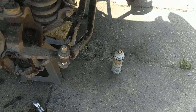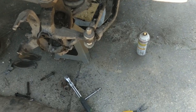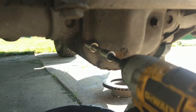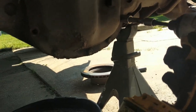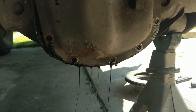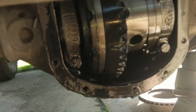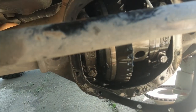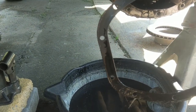Hub and all that's done. I guess we can take the diff cover off and pull out the carrier. For stock, it's half-inch bolts. A little impact makes this a breeze. Make sure to have a catch pan ready. Pro tip: leave a bolt at the top so when it finally breaks free, it doesn't fall. Remember when I mentioned gaskets were easier? This is why — you just sit here and peel it all off. Five seconds of work, you're done. Don't mess around with RTV. It's not worth it.